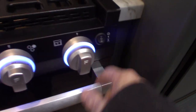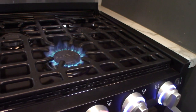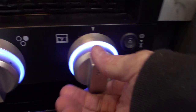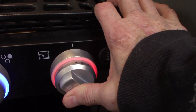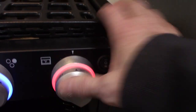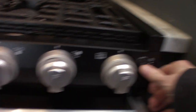And then this one is the oven knob. The oven is a little different — there's a pilot light all the way at the back on the bottom. You go to the oven knob, go to the picture of the flame, depress it, then light the pilot light. Once it lights, hold it for another 10 to 15 seconds to heat up the thermocouple. Then you go to whatever temperature you want. When you shut it off, the pilot light goes out, so you have to relight the pilot light each time you use the oven.